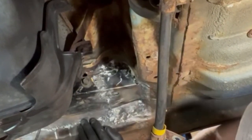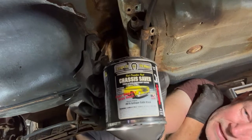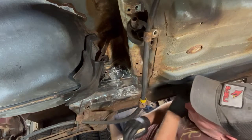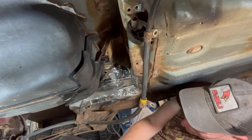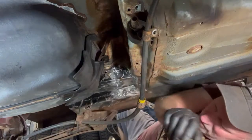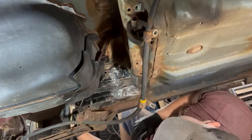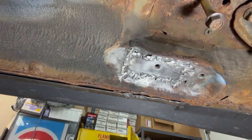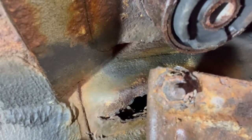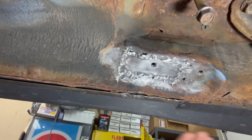All the welding work's done. I took a wire wheel and grinding disc and cleaned up some of the welds. I'm going to give it a quick coat of chassis saver — it's kind of like POR-15, a poor man's version of it, though how much I paid for it, I don't think it was very cheap. I'm just going to take a brush and go along — all I want to do is save the material from rusting. The one thing I really don't like about this stuff is it takes forever to dry, and in about 10 minutes I'm going to start putting this thing together, so I'll have wet paint all over me.